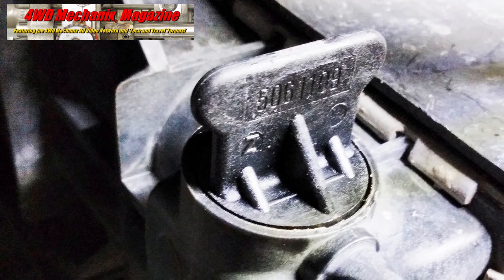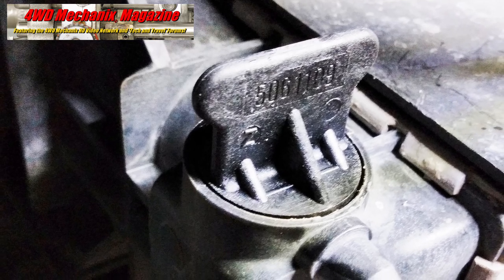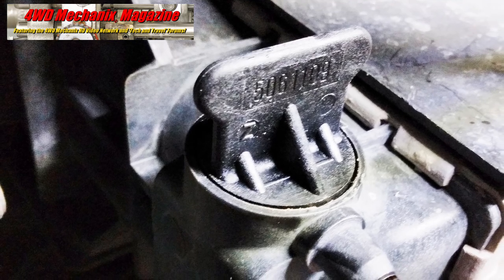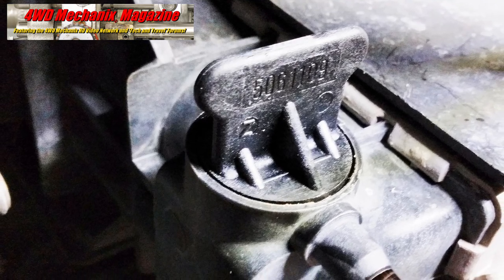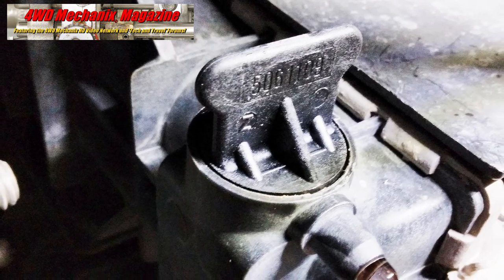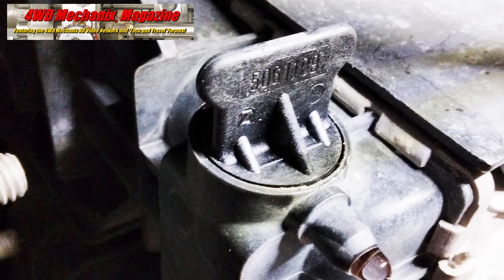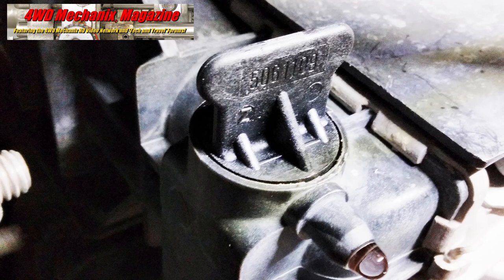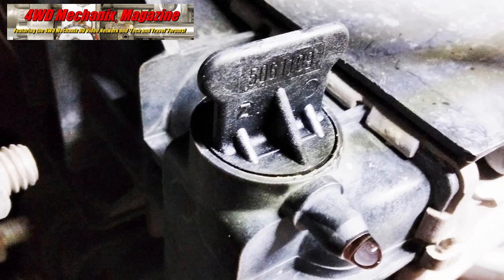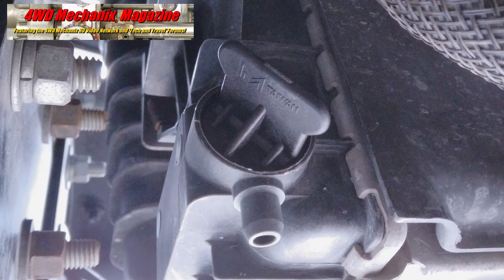This is a stem with the seat snapped in place and the few threads caught. Turning the stem inward clockwise will spread the flanges onto the stem shoulder. This secures the threaded seat in the radiator. If you only screw the stem out this far to drain the radiator, you will avoid trouble. The coolant will drain straight down and well. Do not unscrew the stem all the way. You may not get the stem threaded back in place. Have a stem and seat kit on hand before draining the radiator. Clear distilled water has drained and the drain petcock is snug and leak free.